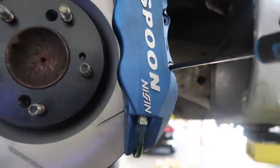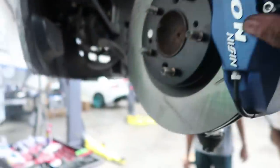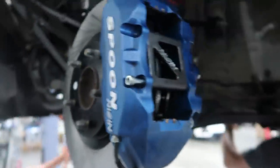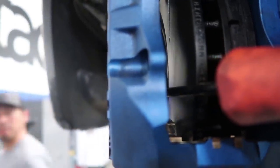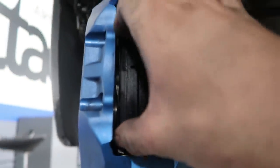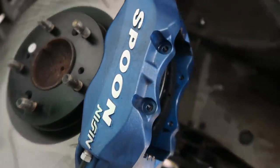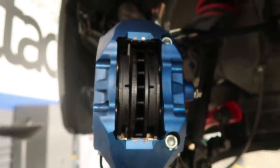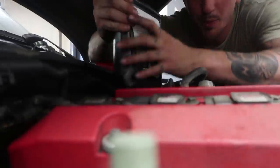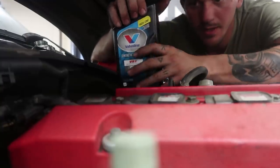One really awesome thing I love about the Spoon brakes for the S2000 is it's extremely easy to change out your brake pads. All you do is remove this allen bolt right here — this is probably one of my favorite parts of the car. Remove this, take the bracket out, and then you literally just slide in your brake pads. Get one pad in, push the other side in — and that's it! Put the bracket back and they're good to go. Moving on, we're gonna do an oil change before the track day using Valvoline VR1 10w30 — this is what I use every time.